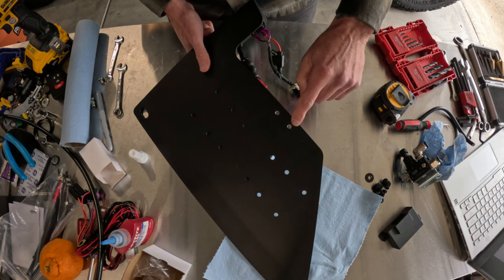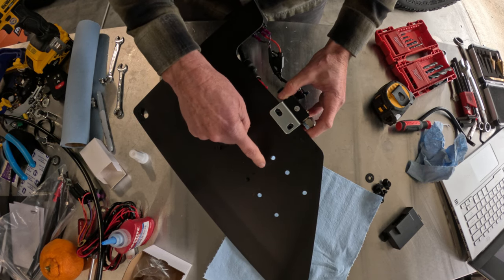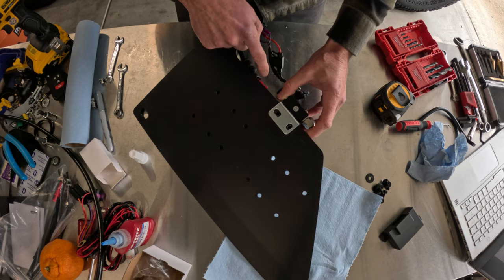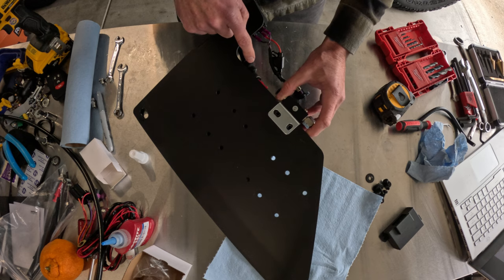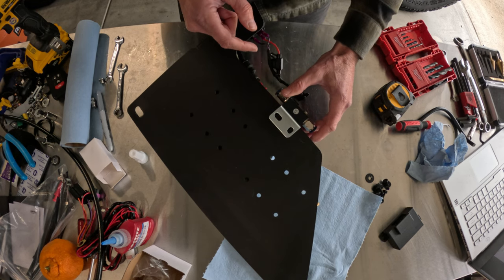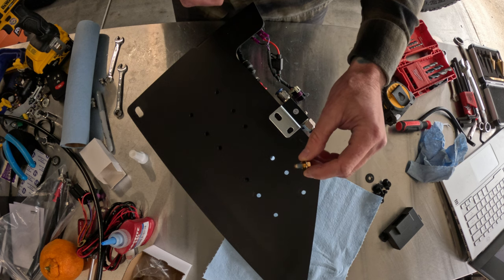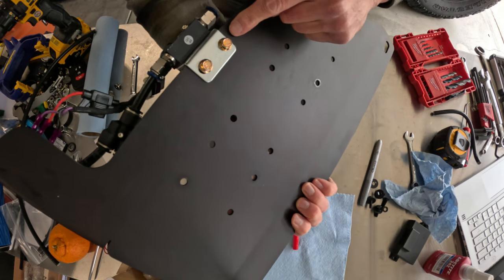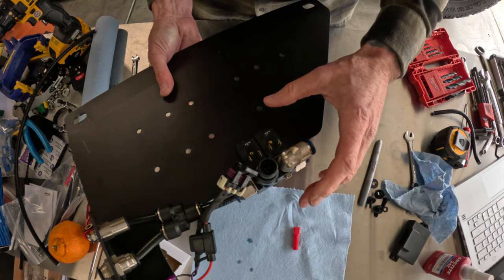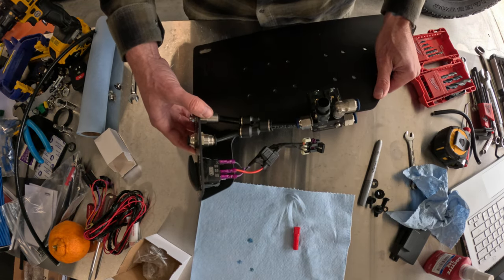I've gone ahead and added a couple of quarter-inch holes here that will allow me to bolt the fixed bracket. I'm going to have to take the original compressor mounting locations and move those in slightly to make room for this new mounting location, but I think that's going to allow things to line up pretty well with the hose on the side. I put a little blue Loctite on the bolts since this lives under the seat. I drilled the new holes equidistant from the two existing spaces, lined up right where the fan goes into the compressor area. I cut a small piece of hose to go across here and there's a slight angle but it looks like it's going to work out well.